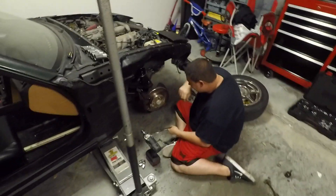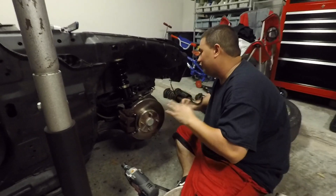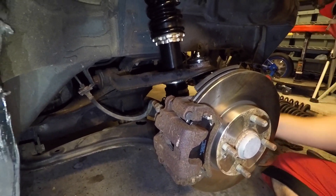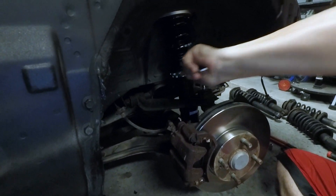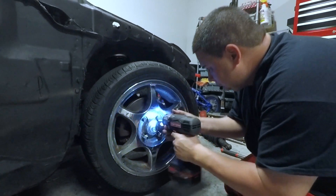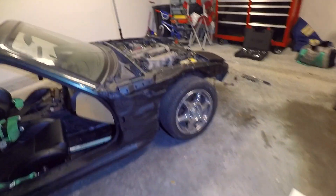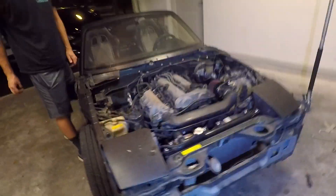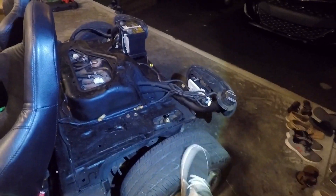I don't think I would go lower in the back at all. Justin says he's a professional at adjusting coilovers - he had an Evo with a lip and it was brutal. You loosen up the bottom first, spin it down as low as it's going to go, keep going until the bottom ring meets the bottom, then get your small spinner, tighten it up, throw the wheel on, test fit. The Miata's on the ground, all coils adjusted - we got some epic camber, probably four to six degrees. We maxed out the front, the back looks perfect.